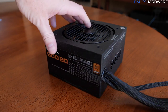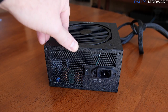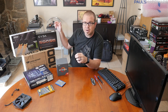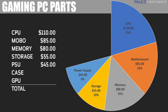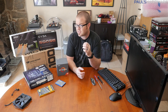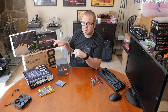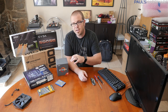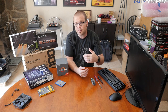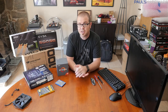For a power supply, you can get away with a $40 to $50, 80-plus bronze-rated unit. I've chosen the EVGA 500BQ. You can get the EVGA 500B for about $45 — it'll get the job done, though the cabling may not be that nice. The BQ has all-black cabling but costs $5 or $10 more. With a 500-watt power supply, you can get the system running with a little wattage headroom, so if you upgrade your graphics card to something that uses more power, you'll be okay.